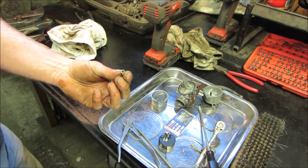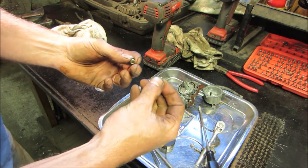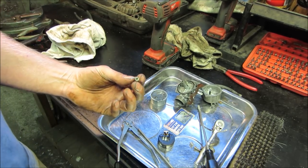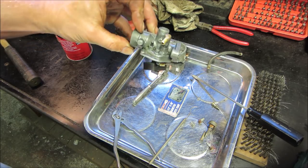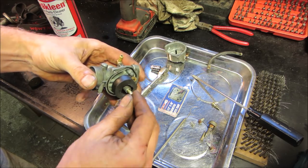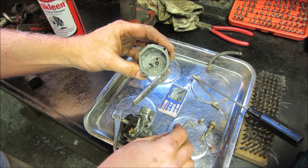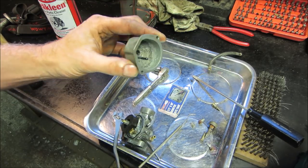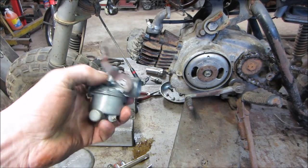Looks pretty shiny inside. Go wash that up and see. I would have thought there would have been a seal on the bottom of that — usually one or the other has a soft tip to seal on. It seems to be working: you flip it that direction, blow in through the fuel inlet and it's off; you flip it over and it blows through. Hopefully when we put it back together it will do the same. I'm going to take a little minute and pick away at some of this crap in there, then put the bowl on with the jets and adjusting screws back in it.